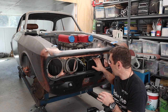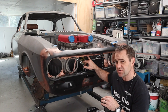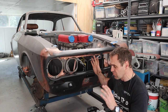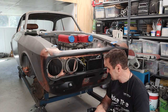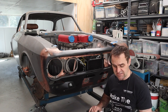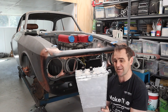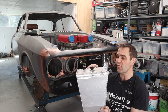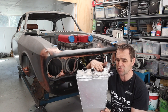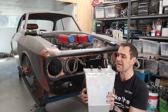The PWR oil cooler is now mounted and has some hoses. I need some longer bolts to mount it up above here and I'll get them in. The next thing I want to tackle is go back to my dry sump oil tank — a bunch of you were asking about pressure testing it, and that's what I'm going to do. But before I do that, I have to make the gasket to go in the top between this bolt-on top section and the top of the tank. So let's start making a gasket.